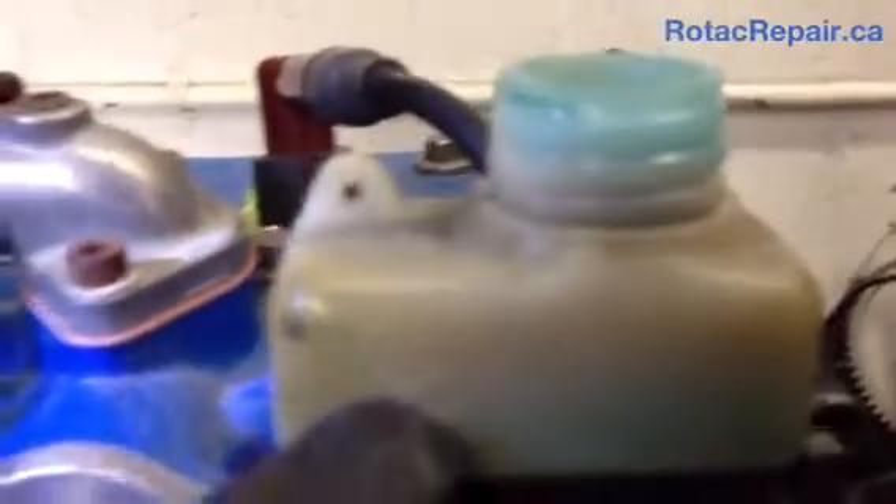We can see there's already that much oil in the can. Let's go back up and look at the bottle — it looks like it still has oil in it. We'll take the top off and have a look inside, and no, it's empty. So what does that tell us? That tells us that besides looking at the level on the side of the bottle, we really should look inside to confirm there's actually fluid there. The dye in the oil has stained the bottle so it looks like it has oil in it. Important note: check the oil visually by taking the lid off and looking inside.